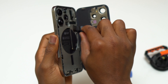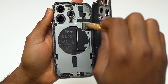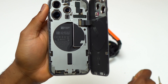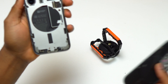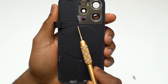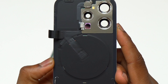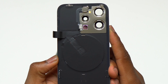Since the flex cable is on the opposite side of the camera, you need to open the back cover on the camera side first. Before fully removing the back cover there is one screw that needs to be removed. After removing that screw, you can disconnect the flex cable attached to the motherboard — simply hold the flex cable and pull on the back cover. This is the removable back glass of the iPhone 15 Pro: a single-piece back cover. On it we have the charging coil, the external microphone, and the flashlight, all sharing the same flex cable back to the motherboard.